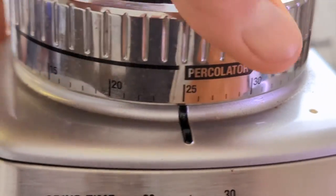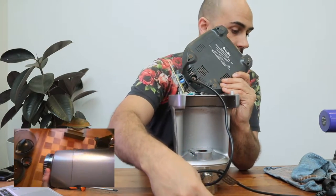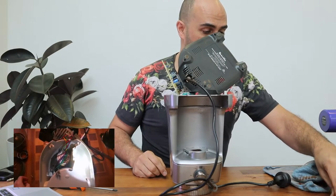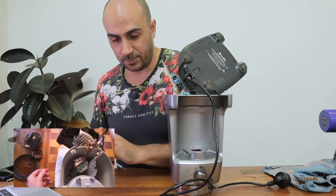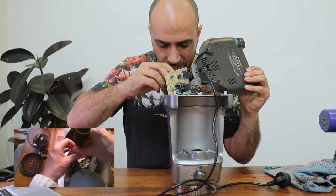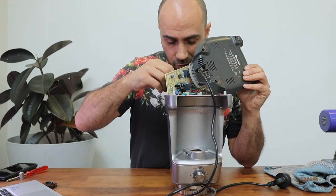It goes down to the finest setting and we can rotate it all the way through to the coarsest setting. Now we need to reinstall each of the four screws. Be very careful because they are actually different lengths — the longer ones are fairly sure the ones that go inside. Definitely use a magnetised screwdriver because if you drop the screws anywhere but the hole they go in, you've probably lost them — there are some chasms down there where you'll never see the screw again.